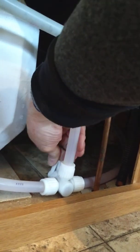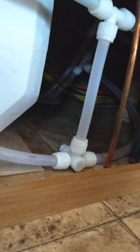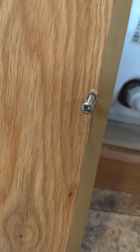But right now I'm putting it back to camping mode, right like this. So that's all set. The bottom line is you can't get antifreeze into the water heater. There's a panel that was on there. I'll put it back. It's just held in by these number 2 square-headed screws. Let's see if it'll focus that close. Nope, a little back, a little farther. There we go. So it's a number 2 square-headed screw, so you want to get a bit for your drill that's like this here. Okay?